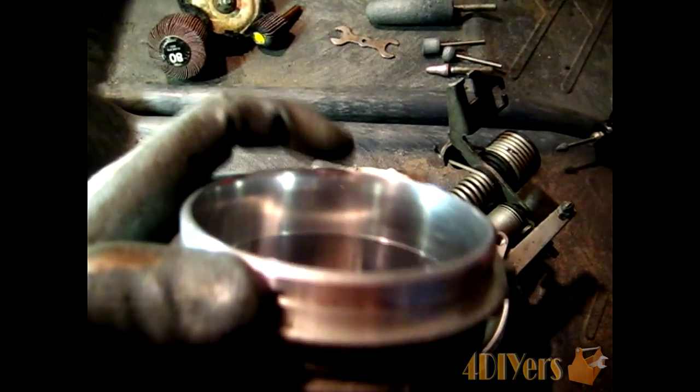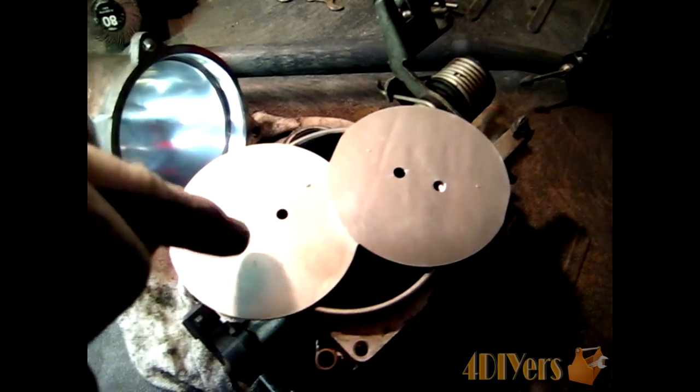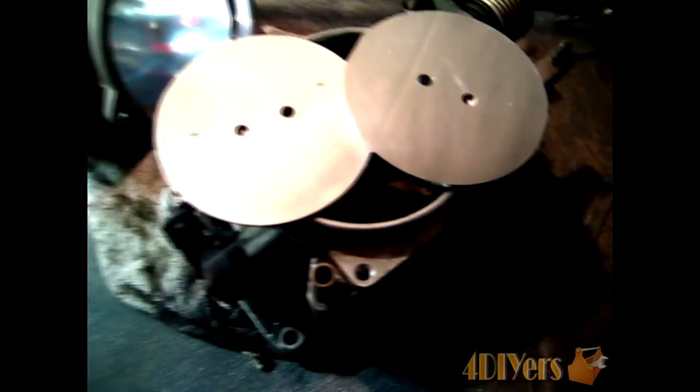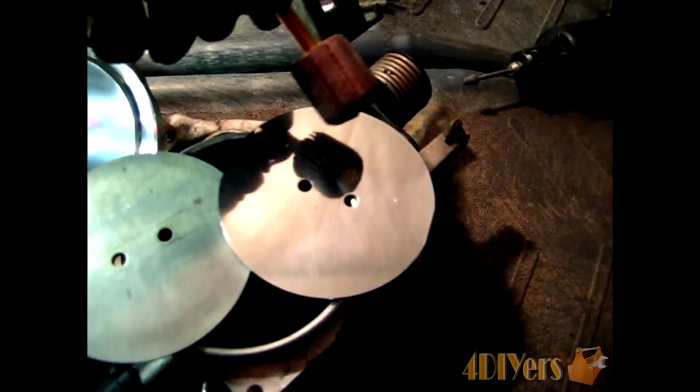On this side here, if you have a direct intake hose that bolts up here, I have opened it up slightly — I didn't want to cut too much but I want it to direct airflow nicely into the intake without too much restriction. Now as for polishing the throttle plates — this is aluminum material, though ones I have come across in the past have been made of brass. You can see I have polished these as well. This one is for the throttle body and this one is for the traction control system, and you can see the nice mirror finish.